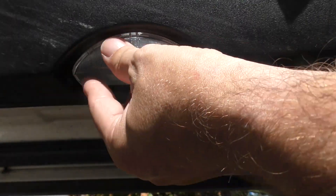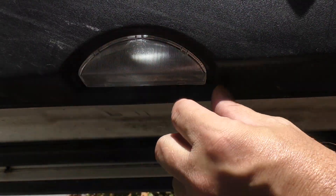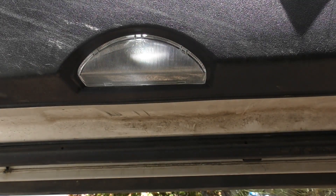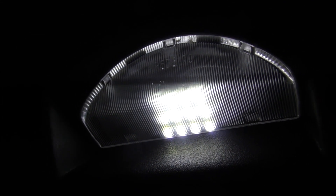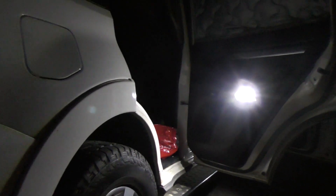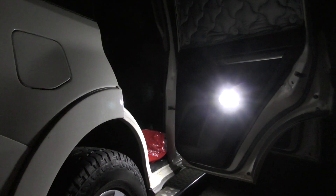For refitment, two tabs on the bottom, up in there like that, and just give it a push and it'll just clip in. All your doors are exactly the same - passenger doors, rear doors, they can all be done the same way. Just grab it on the corner, find somewhere you can get under with the screwdriver and pop it down. So that's the one we replaced today in the front door. Let's open the rear door which has the other one - and you can see that's quite a bit brighter. That's one of the kit ones which has 12 LEDs. You can see how much light that panel is outputting. It's quite a bit of light - keeping in mind it is higher up as well - so if you're really after light output, maybe for camping or something like that, have a look at this lot.